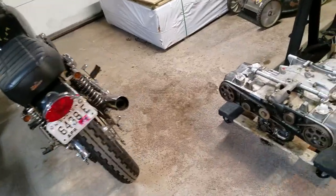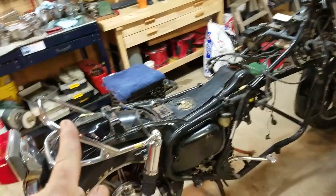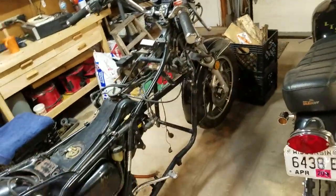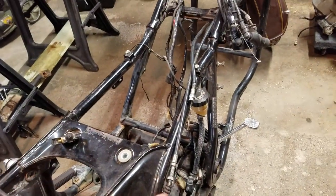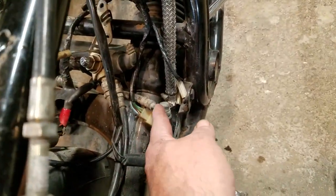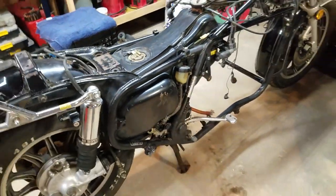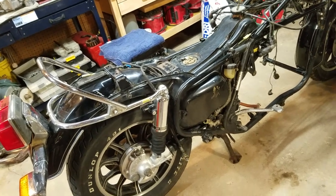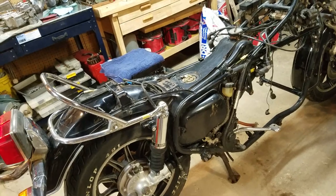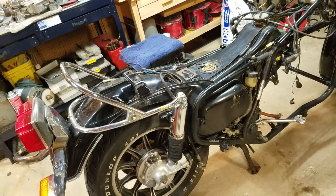This bike has a shared brake system — when you squeeze the front brake lever it applies the front brakes and the rear brake; if you hit the back brake it applies the back brake and the front brakes equally. I believe this master cylinder is shot. This one however seems to be good — there's brake fluid in there and it's holding very nicely. However, this one has a banjo bolt connection whereas this one has a hard line connection. Godfrey gave me a couple ideas on how to swap them, because replacing that isn't cheap. He offered to rebuild it for me, so worst case I'll do that. The other one's been empty a long time, which means the seals are probably dried up and no good.